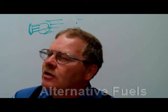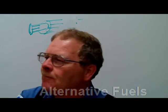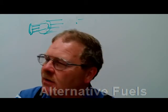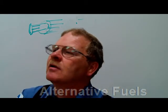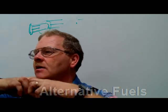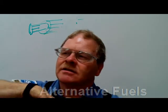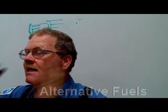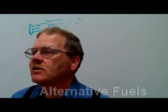Anyway, the long and the short of it is you go leaner than that. A leaner exhaust is hotter, and you're going to get oxides of nitrogen. Now, we got 78% nitrogen, 21% oxygen, and whenever you get over 2,500 degrees in a combustion chamber, you're going to start locking those together, getting oxides of nitrogen compounds, and that ain't good. The catalytic converter takes care of this for us, but there's only so much it can do.